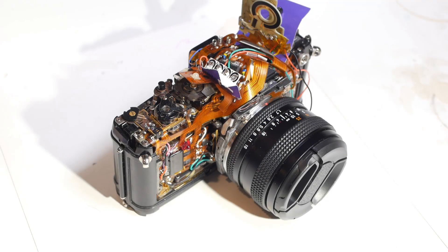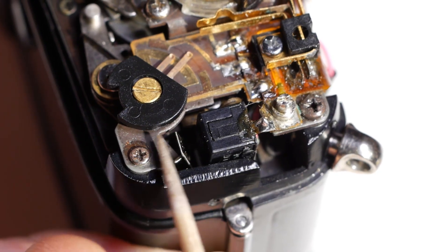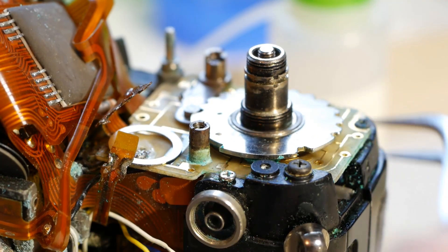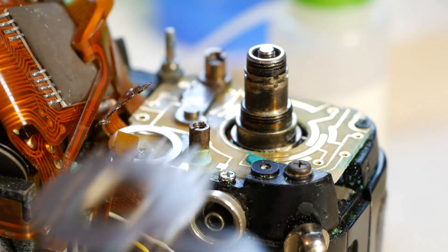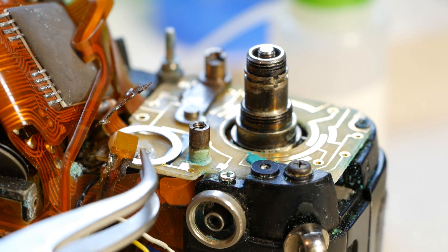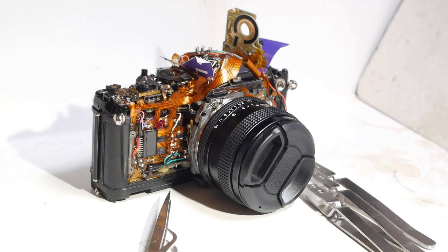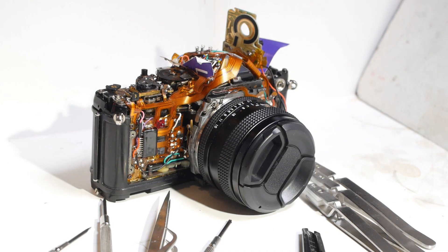Shortly after that I was firing the camera and it appeared to jam. Upon investigation, the transfer switch has now failed, so it was attempting to advance the film while the winding lock was still engaged. I knew that the transfer switch can be a cause of problems on these cameras, and I'd checked its continuity several times, but it's entirely possible that the contacts inside are corroded, just like everything else on this camera, and I might need to find a replacement switch. So in the best traditions I'm going to end the video now. If you've enjoyed watching, please like the video and maybe even subscribe to the channel, not forgetting to click on the bell icon so you get notifications when a future video is released. Thanks for watching, and I'll see you in a future video.